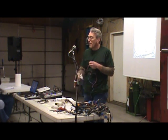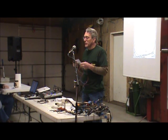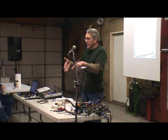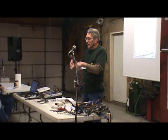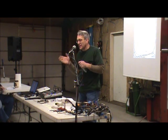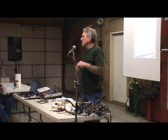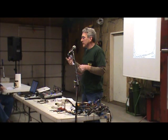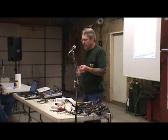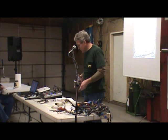Would you put dielectric grease on that too before you close it up? I don't know, no, you really shouldn't have to because the barb actually pushes the insulation apart. So you've sort of got a seal between the insulation and the barb. So in some respects, it's kind of weather tight, but some come with it inside already. Yeah, dielectric, they're making improvements to these. But again, it's kind of a modification. You do want to keep some of those things to a minimum.